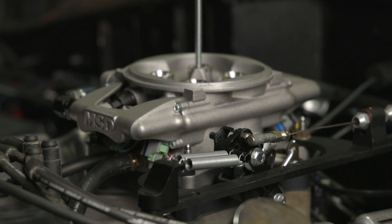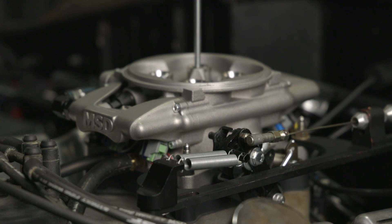This makes a huge difference in your driving experience. Holley's throttle lever not only works with Sniper EFI but also MSD's Atomic II. You'll need some additional washers to make it work, but this modification is going to come in really handy when we go off-roading.